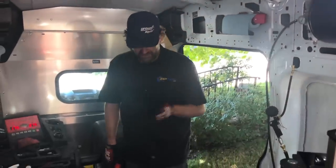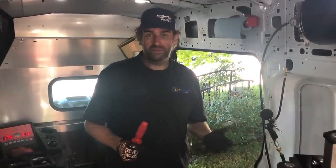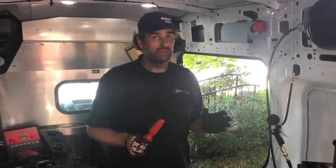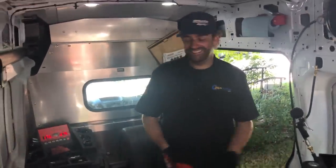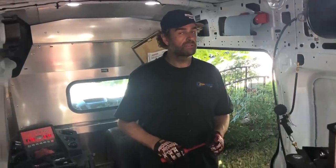With a mud terrain tire on a 40, there's so much vibration going on all the time that it's actually hard to tell if it's out of balance — but it's still worth balancing as best you can. Mud terrains are simply not going to wear like an all-terrain or street tire would, no matter what you do. This is a big chunky mud terrain tread block: as you're driving along, those big square blocks hit the road with an edge for paddle-style clawing traction. When that block comes around to the bottom in rotation, it hits the road and makes noise, versus an all-terrain with more interlocking tread blocks on a chevron angle that creates less noise and heat.